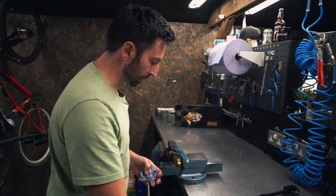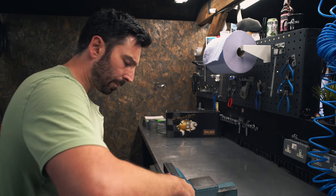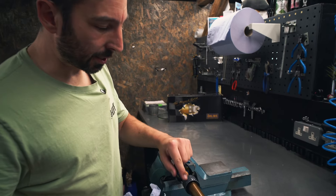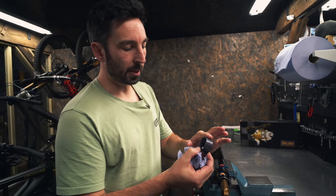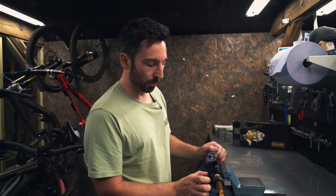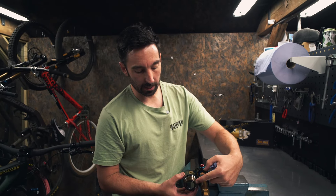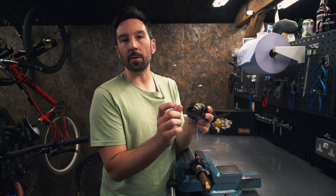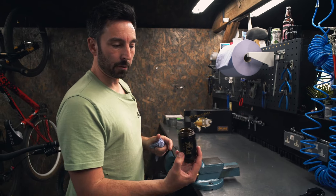All looks pretty normal to me, but we'll pull that apart and have a look. Instantly we've got something that looks very non-standard - there's this huge gliding section here which I can take off. This polyurethane or plastic gliding is after the main seal. This is the seal that actually separates positive and negative air, so all your positive air pressure is sat in this part of the shock - that's the bit that supports your weight. Then you've got a negative air chamber that sits between this seal and the outer seal of the air can - that's the bit that provides an opposing amount of pressure to the positive air, so it acts like a little cushion at the end of a rebound stroke to make it feel more like a coil shock.